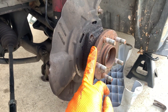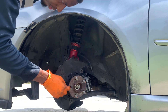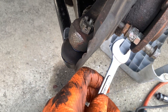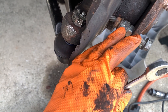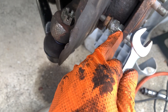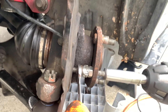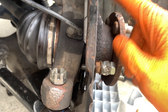From this point, all I have to do is knock this loose. Give it a couple of whacks with a hammer and knock the stud out. What I did was get a bolt and a nut that'll thread onto it — I used a lug nut and an oversized nut. I fed the bolt through and put these two nuts on so that when I use the impact to tighten it from this side, these two nuts will be pressing up against the hub itself. You can now see the gap between the hub itself and the actual knuckle — that's what you want to see.